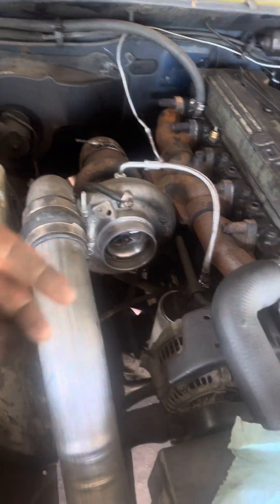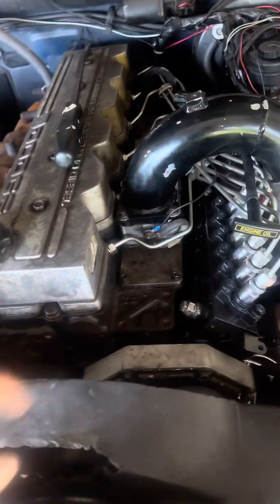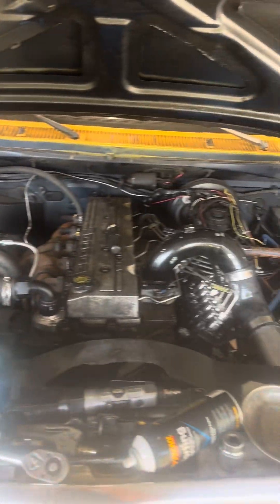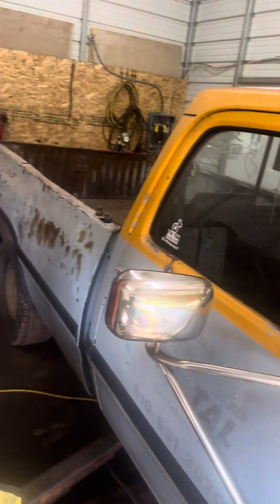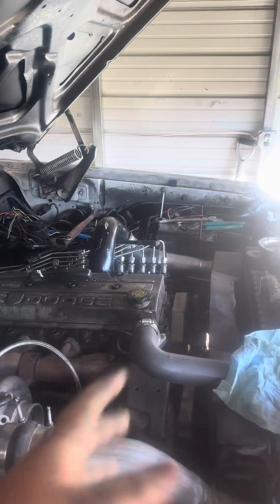I can put the air intake piece on once the electrical is in, because it's a pain to get to the wire hookups on the back of the alternator with the air intake on. I already primed the pump with some motor oil using a syringe, and it should be ready to fire up. I still got the injector lines cracked open to bleed the air out. I should have this done before the end of this Memorial weekend — then get the idle speed set, do a little tuning, drive it, and check for differential leaks and the temperature sensor. We are getting to the final stretch.